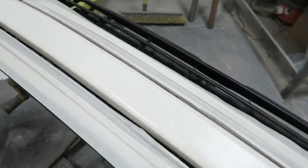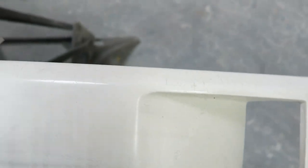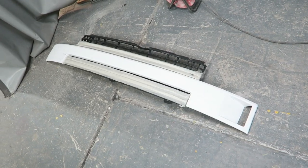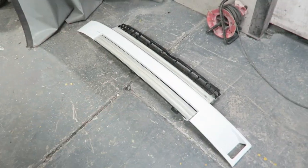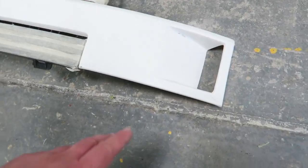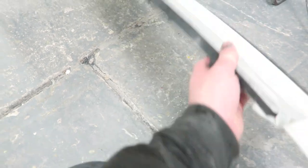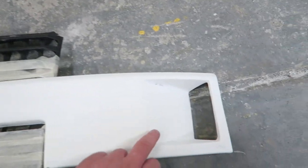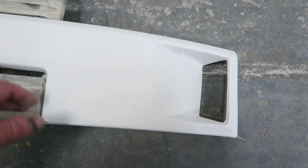Now for my front panel — just masked all this off. You'll see here where the paint's just cracked and gone horrible. When it was metal it was fine but whatever happened with the plastic one I didn't do it properly. I'm going to take all this back, get it nice and smooth and get it ready for paint. It's amazing how long this sort of stuff takes — it's taken me an hour and a half using the DA getting in there with 120. If anyone wants one of these panels let me know. It's fiberglass — you have to bond it onto the back to get it to fit. This is my own design with the scoop brought to life by Kelly at Audiosport. Drop me a DM on Instagram.